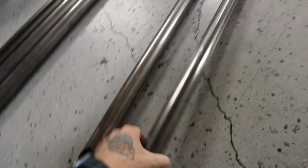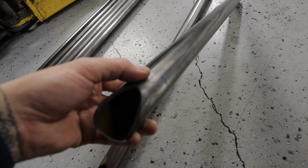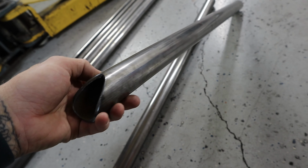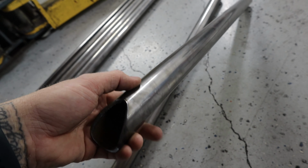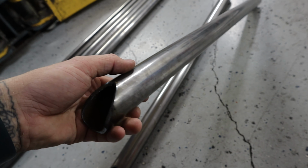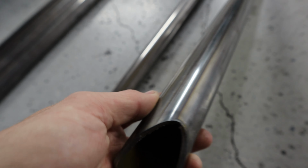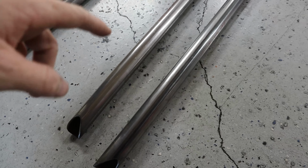Now, I don't know how it is with drag racing, because again, I am new to cages, so I don't fully know what the NHRA specs and regulations are for it. So this cage on the website from JEGS, this is a Rhodes 10-point roll cage, and they say it meets or exceeds NHRA, SCCA, or something like that standards. But you see what you see here, this is a seam line. So this is actually hot rolled electric welded mild steel tubing.